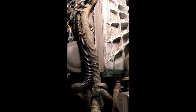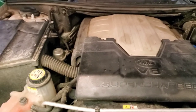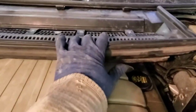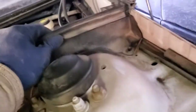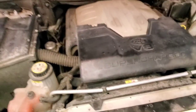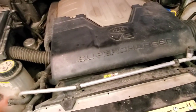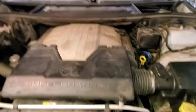Now I'm going to put the cover back on, put the plenum back on, and get this thing out on a road test to verify everything is working well. The engine is dirty — I do take this thing off-road a fair amount so it gets beat up. The cover goes back on, then the plenum with the 13 millimeter bolts — I put about 20 foot-pounds of torque on those, not overzealous. Center the seal back in place and make sure the gap is even on both sides. No busted knuckles and no confessional necessary — everything went okay.